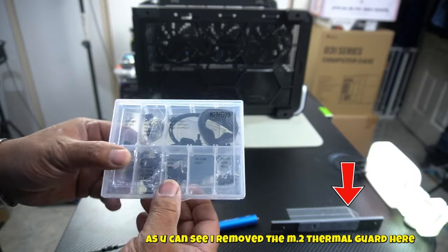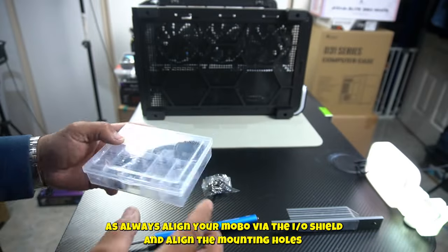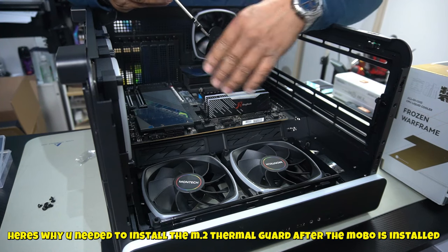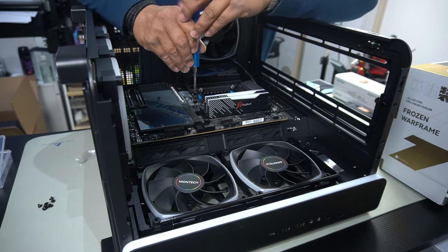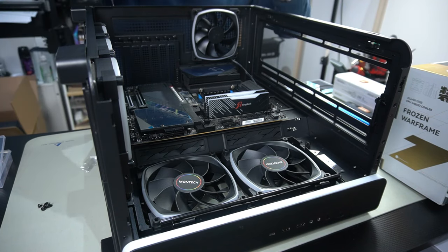Here is your box of goodies — as you can see, everything is listed here for you, telling you what goes where. Our motherboard screws are these ones here, so grab them and secure our motherboard. We'll start off with the two that are hidden by the M.2 slot, that way we can get our M.2 straight back on. Now we can install the rest — that's two in, so we have seven more left.